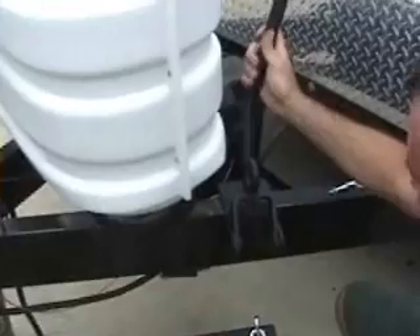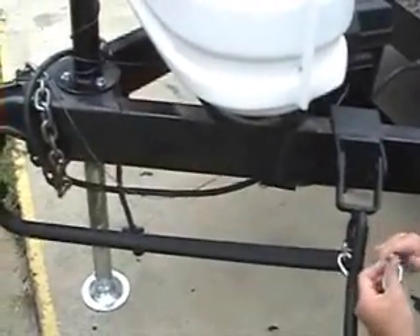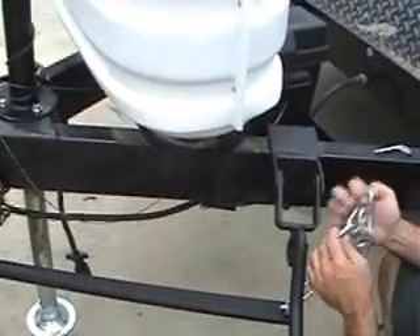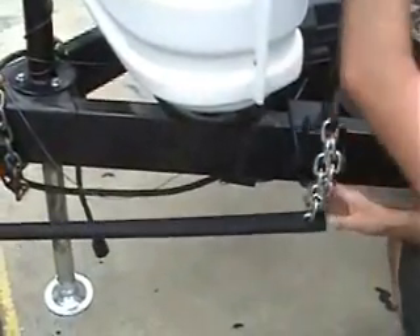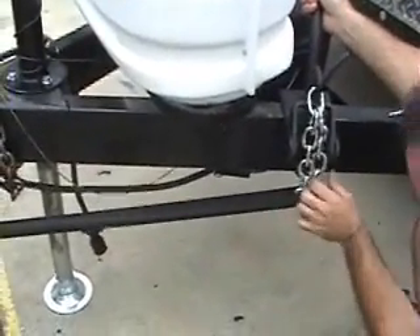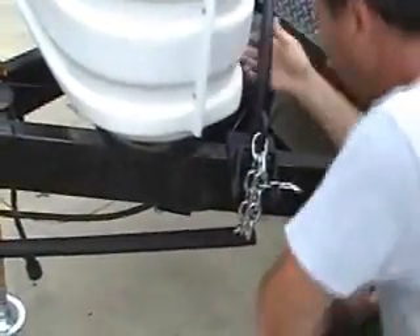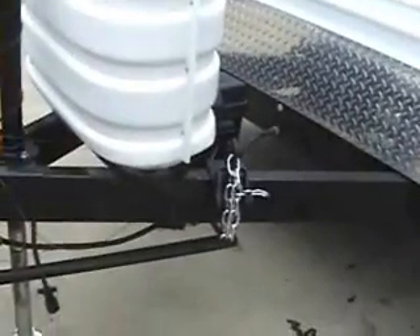This bar here — it's for this right here. Pull it down. Now I'm going to take this right here. I don't know which chain link to put this in. The more of these I grab, the higher it picks up the back of your truck — keeps your trailer from squatting. See how loose that is? One, two, three, four, five — I've got five links, five open. I'm going to leave it right there. The reason it's loose is we've got the truck picked up in the air. Now we'll set it down and see what that looks like — I might have to adjust.